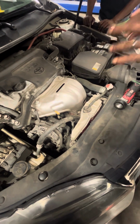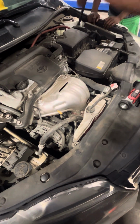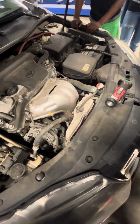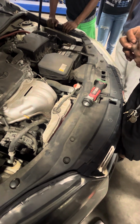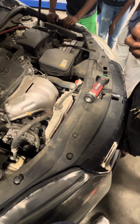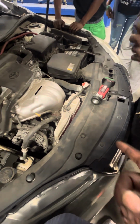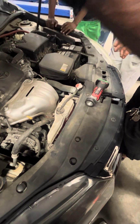Okay, suppose there is no blockage in the cooling system or the heater core, but the customer complains that it's not putting out any heat. What's the first thing you're going to check? The hoses? Anybody else? Thermostat. Anybody else? Check the fluid level, make sure the fluid level is where it needs to be. What would be the first thing you check?